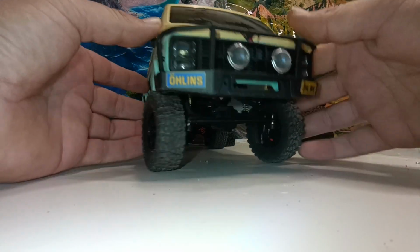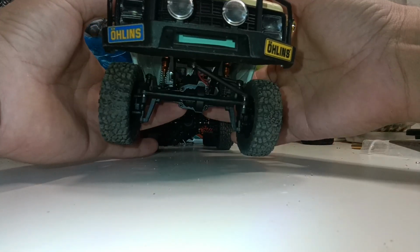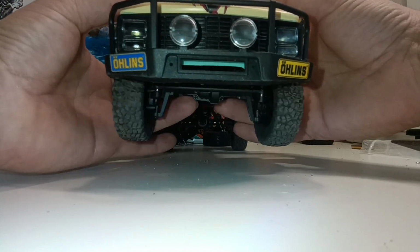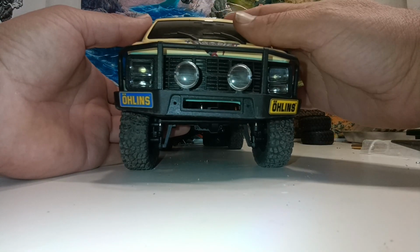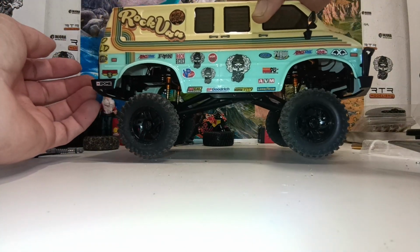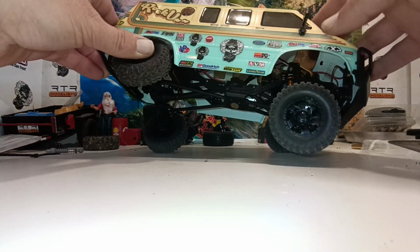Okay guys, as you can see, it stopped that problem now. You can put the steering straight and it stays straight even when it's out. It has a minute turn when you push it right in, but it's nothing like it was, okay guys? It's 100 times better. So that was the last thing we had to do the conversion of the double barrel shocks from the SCX24 on the rock van, guys. And as you guys can see, there's a humongous amount of droop now, so way more articulation than it had. We definitely got some seriously cool articulation.